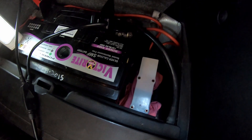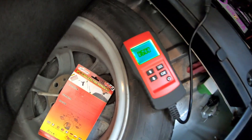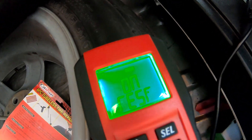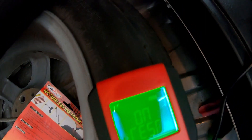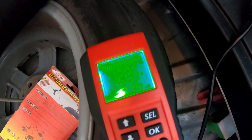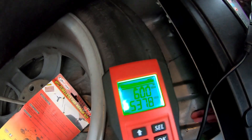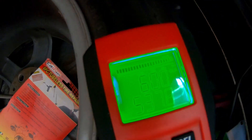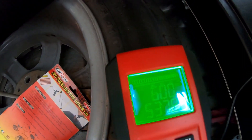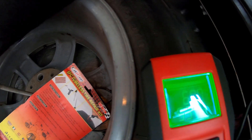Okay, a quick test fitting — I placed the supercapacitor in parallel with the battery. Now we're just going to give it a test and see the result. Okay, 12.86 volts. 537.8 CCA. So we have boosted from our initial 340 CCA to 537. It seems like it's good — let's give it a try then.